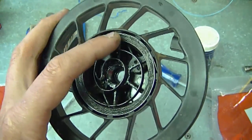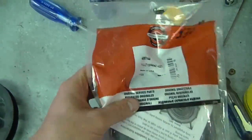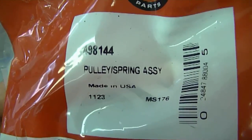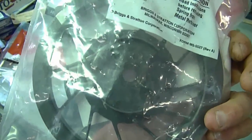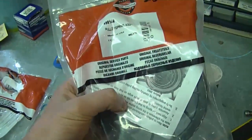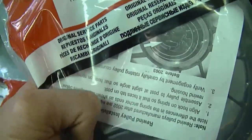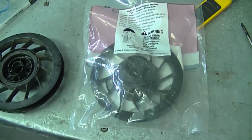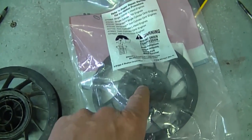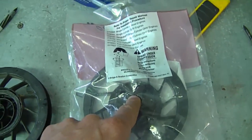From what I understand, you can't buy just the spring — it's the whole assembly. It's a Briggs and Stratton part, part number 498-144, a pulley spring assembly, and you get the whole assembly including the spring. Unfortunately you do have to buy the whole assembly, but there are instructions inside, so just get that part, put it in, and you're good to go. It's the same part on some Briggs and Stratton snowblower engines as well — same pulley, same part number in their recoils.